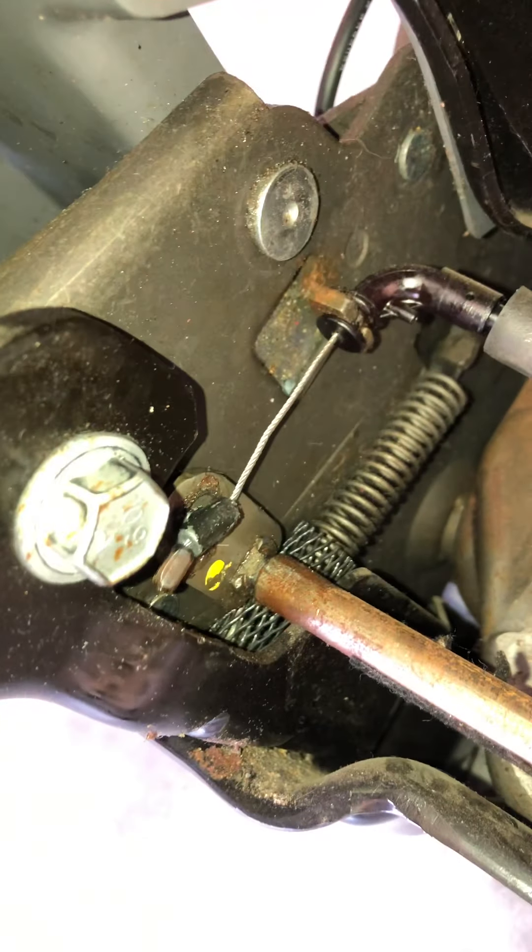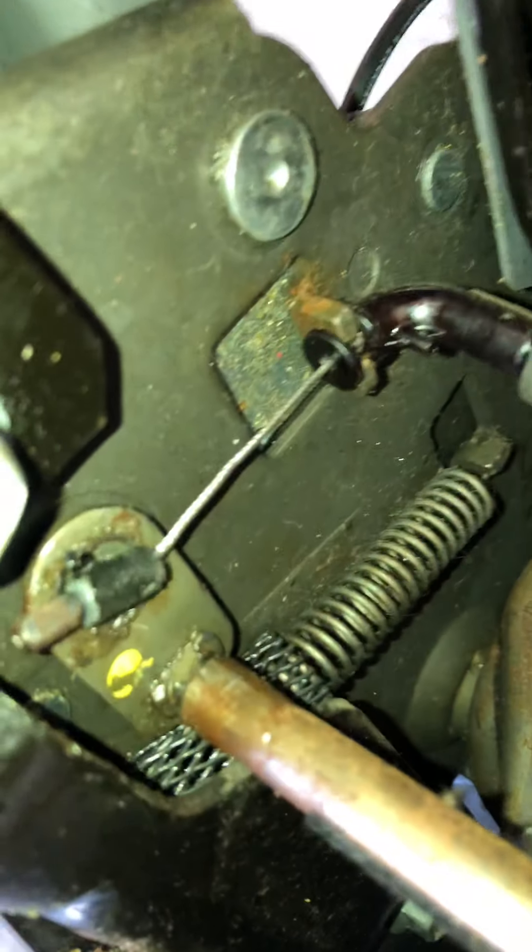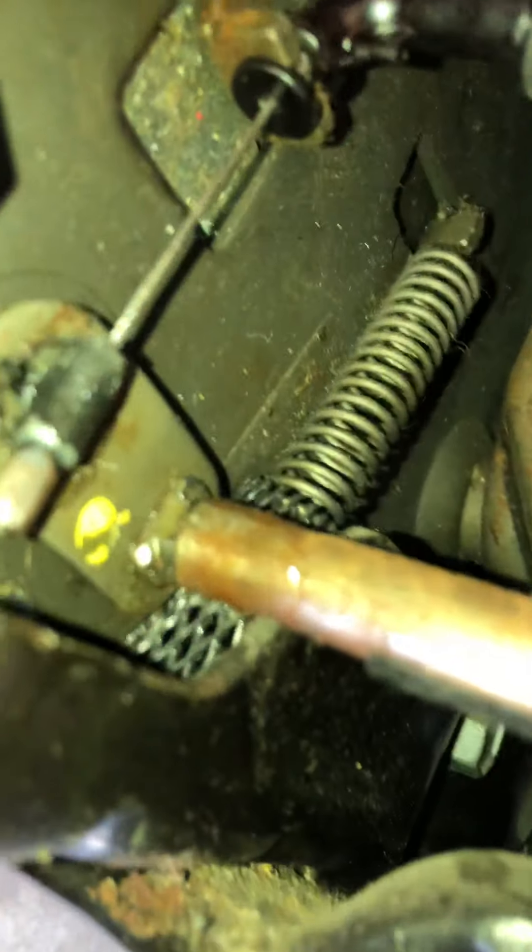On the passenger side, I moved the lever and you can see how the cable stretched. I tried putting a fishing weight on it like some guys suggested, so as it pulls up it'll pull the cable farther. But the problem is this metal bar — it's not moving. It's connected to this side and it's supposed to rotate and release something. It looks pretty rusty and messed up.